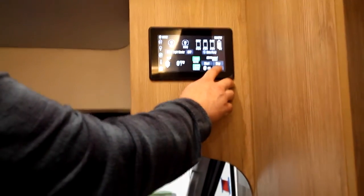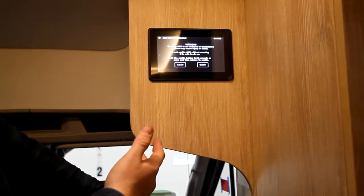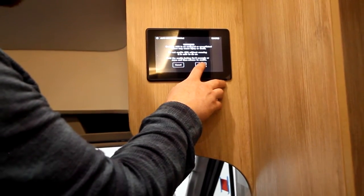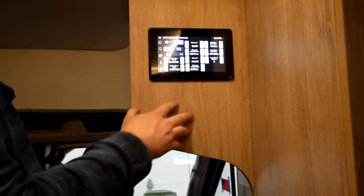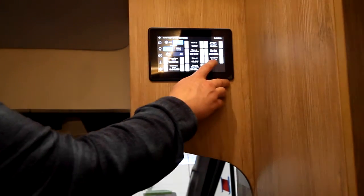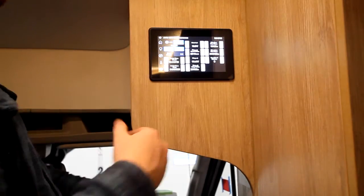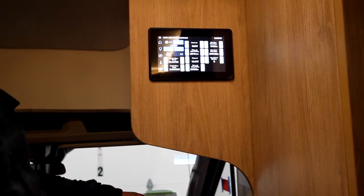Down below that, we have our auto gen start. You press it once to get your warning screen up. Now you want to make sure you're not inside a closed space. To activate it, you're going to hold and press enable — then release once it's turned blue. Now it's enabled. So if we go into a low voltage state, it should start your generator. We have five tries for it to start until it stops trying. We also have HVAC load — so if you turn on your air conditioner while unplugged, it's going to sense that and start the generator, then start your air conditioner allowing your unit to cool down.